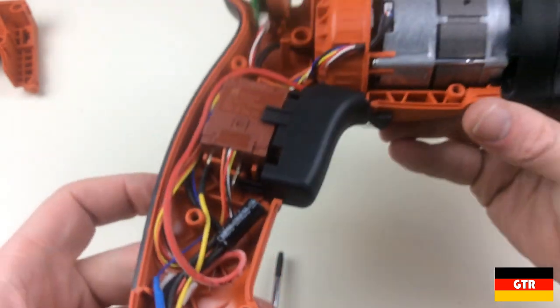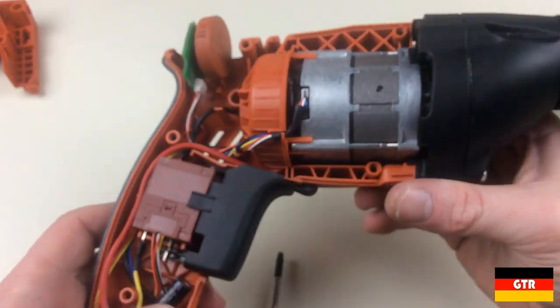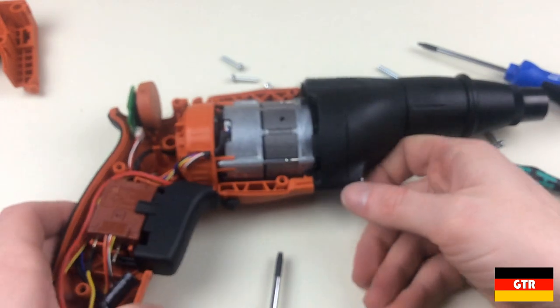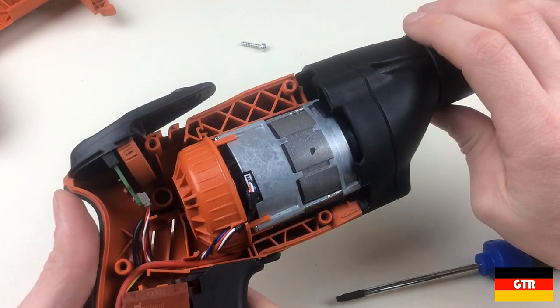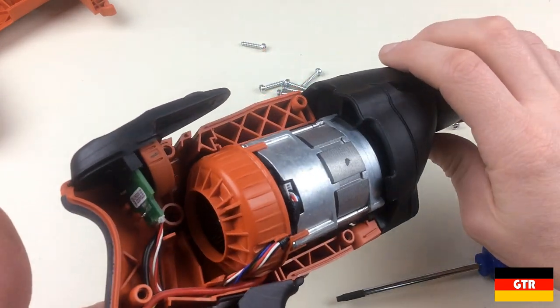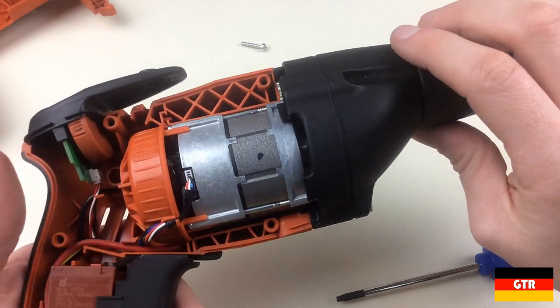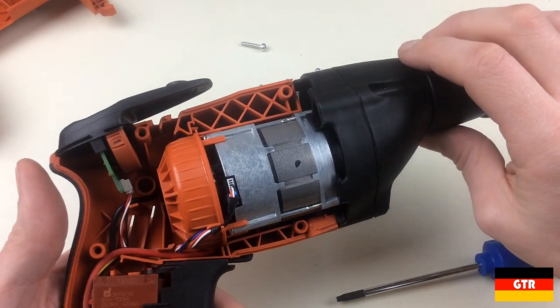Looking up the information on the ZL series, it is a 105-degrees Celsius capacitor. They probably should have gone with a 35-volt capacitor in order to maintain the minimum 30% derating that is normally done when selecting electrolytic capacitors. Since the voltage levels on a full battery will be around 21 volts, this leaves only a 17% margin to 25 volts. If the drill starts becoming flaky in the future, then I would suspect this capacitor.